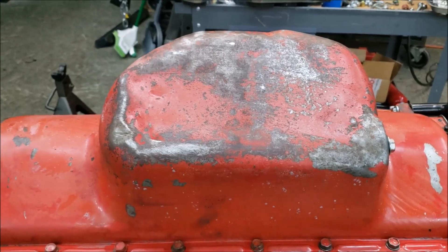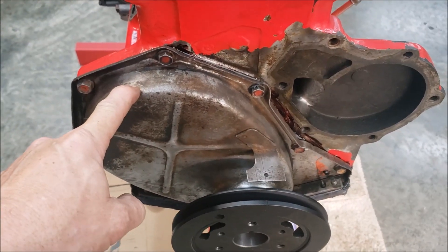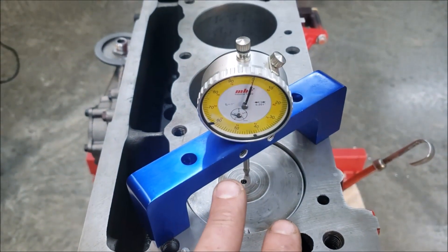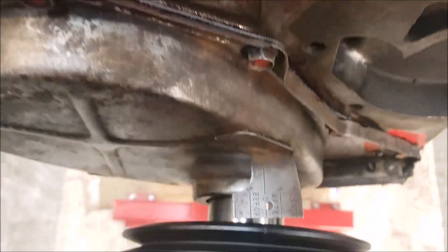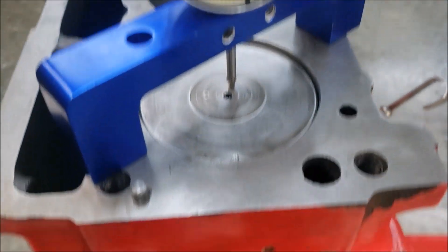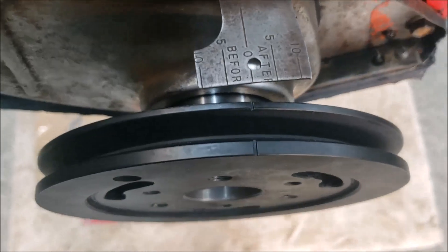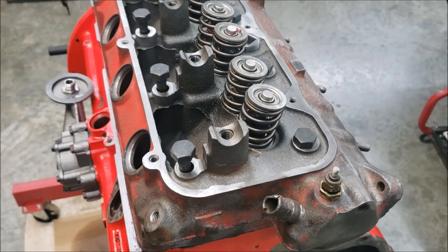Before you paint it, here's another tip. This is a different timing cover than the one he had, because his had an adjustable timing mark and it was not even in the ballpark with this new harmonic balancer. So you get your TDC finder, find TDC - you can rock it back and forth - and sometimes you have to bend the tab. This is how far I had to bend this tab so that it lined up with zero, and that is true zero. Just know that these new harmonic balancers have two marks on them. When you find true TDC, mark it - I'm going to mark it with a little white paint.